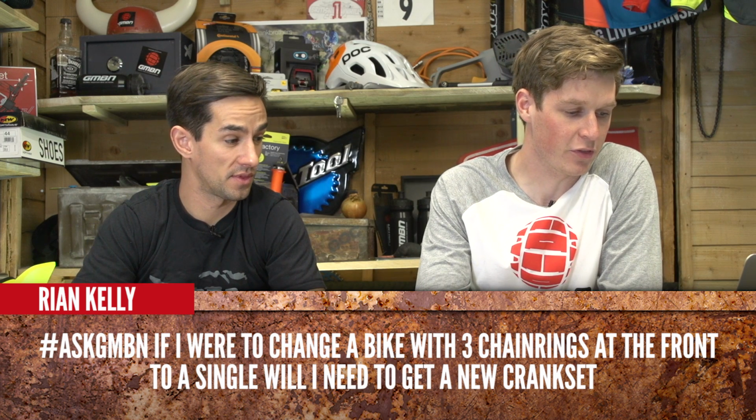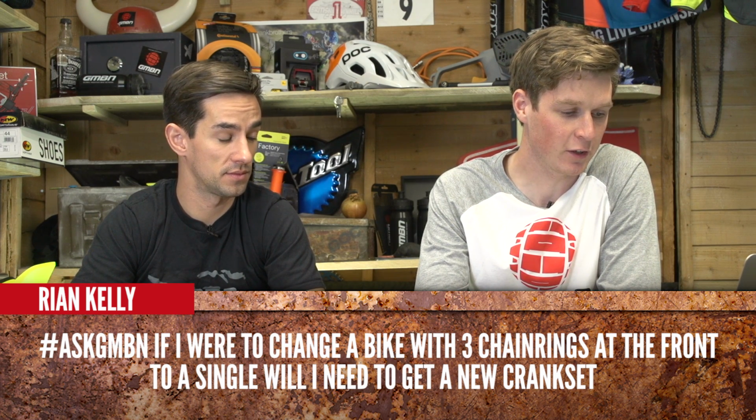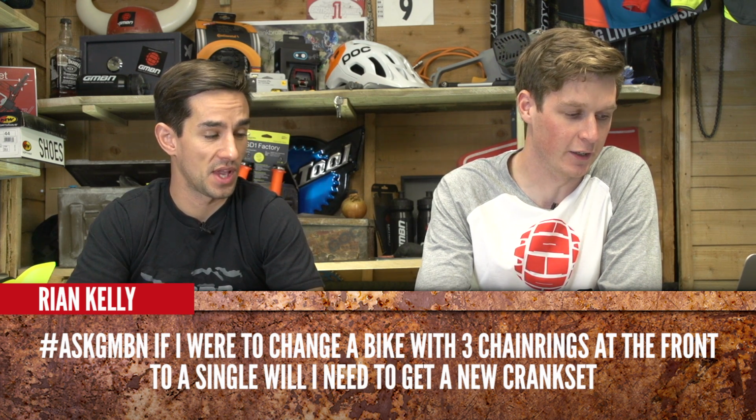Okay, and Ryan Kelly is saying, if I were to change a bike with 3 chainrings at the front to a single, will I need a new crankset? Potentially, yeah, it depends. I think sometimes you can put that single in the middle, where your middle chainring used to be. Yeah, it depends really on how many teeth you've got though, doesn't it? I remember taking the outer one off and the inner one and then having a 32 tooth right in the middle, and that worked pretty well. But now that there's a narrow wide thing, it's probably worth the upgrade, isn't it?